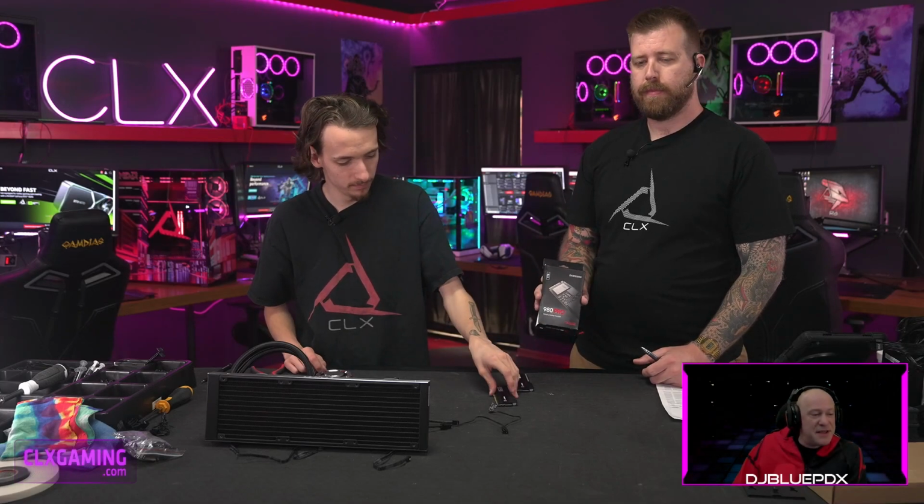Hayden, yeah, let's do our RAM, and then we can go over our M.2 because Hayden just blazed through that too fast. He already did it. All right. So by the way, that operating system M.2 is a 1 terabyte Samsung 980 Pro PCIe 4.0 NVMe SSD. As for the RAM, we've got two 16 gig sticks of G.Skill DDR5 6000 for a total of 32 gigs of RAM. Now DDR5 6000, I believe, is one of the highest you can get. Yeah, it's definitely one of the highest you can get now. I'm sure there'll be some higher speeds coming out later, and there might be some higher speeds on the market right now, but it'd be pretty rare. 6,000 is crazy fast.